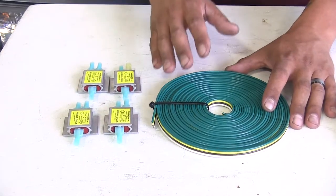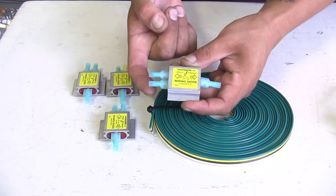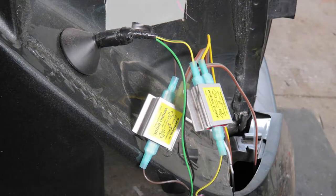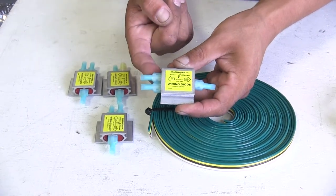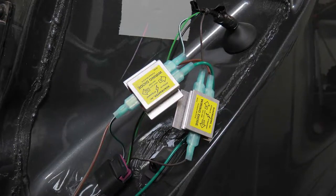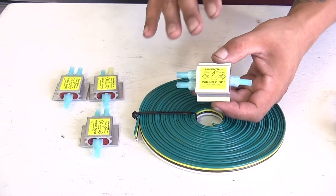If you don't want to have to drill a hole into your taillight housing, our diodes are going to be a good option. Our diodes are going to use the factory wiring on our CR-V. Basically we're going to cut the taillight wire, it's going to go into our diode, and then the output is going to go to the bulb. We're also going to have another length of wire that's going to connect up to the front and run into our diode as well, so we'll have two inputs and one output. All of our lighting functions are going to go to our factory bulb, and the diodes themselves are also going to protect our factory wiring from any kind of back feeding or any other kind of issues that may arise on the motorhome end.